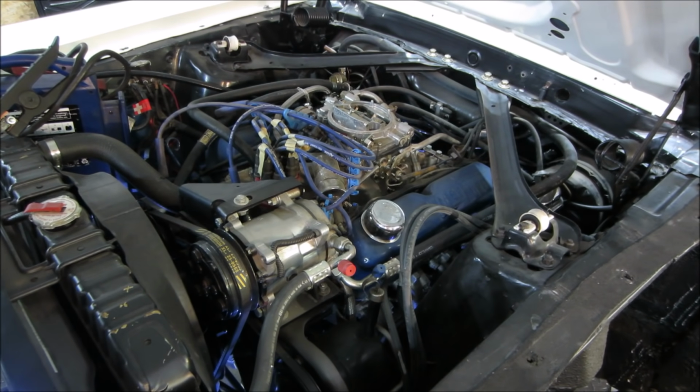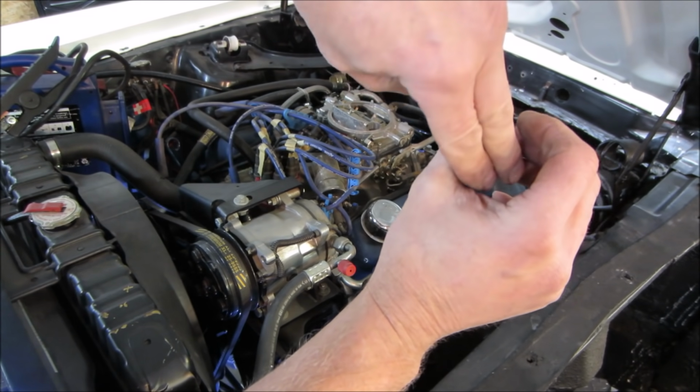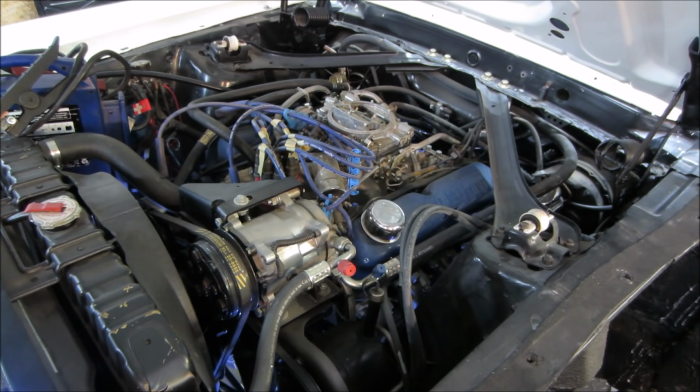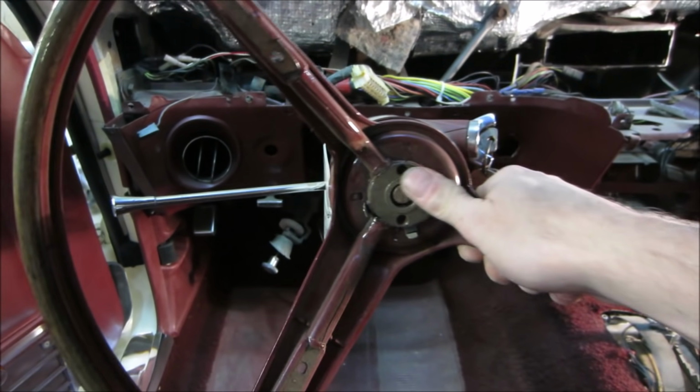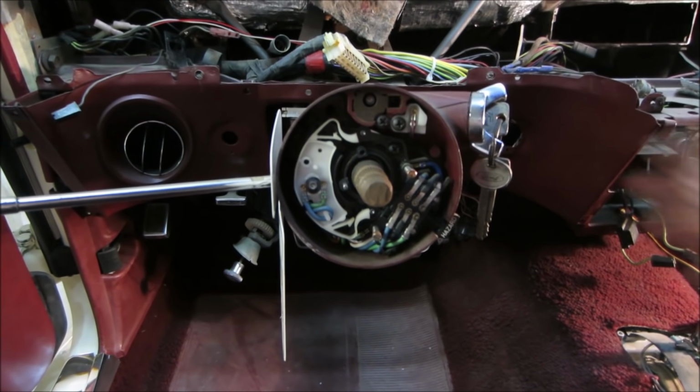Very interesting. I wonder if something's off maybe on the tumbler part of the key and where the ignition switch goes down. It's not turning the electrical connector on it, and it's just left in that on position. That's why it won't crank too. You know, the steering wheel is just sitting on it. Let's see if that's the case, if we could see anything anyway.